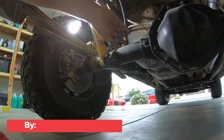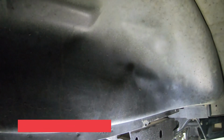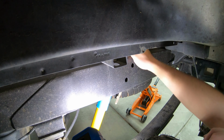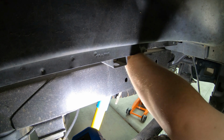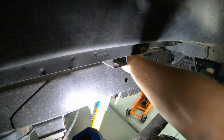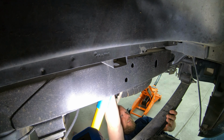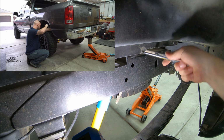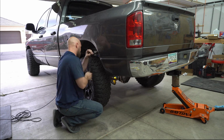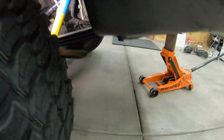Okay, at this point, you can go ahead and cut the shock retaining strap. Get that out of your way. We're done down there. Come back up to the top. You can take your nut right here, stick it in, and put it on the back side of your bolt, if you can reach. Alright, we just barely put that retaining nut on. We should be able to go ahead and get started with screwing that bolt back together. All right, and you got one side done.